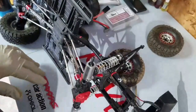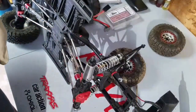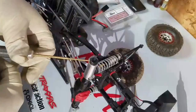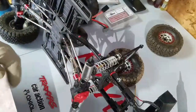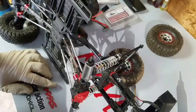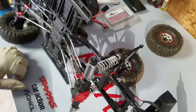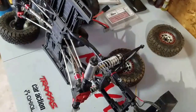I found them all and went over to the pit area and put it back together with thread lock. Anytime you're putting aluminum parts on, you've got to use thread lock. You can't use thread lock in plastic because it will damage and eat up most plastics. The trick for plastic is to take a tiny dab of super glue on the threads — and you might think it's never going to come out, but yes it will. It's not that potent, but it's definitely something you've got to remember.